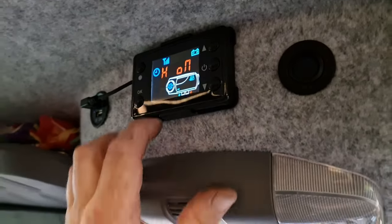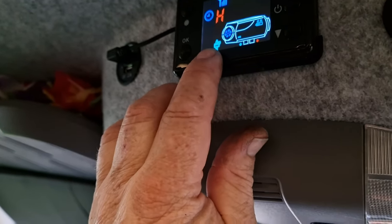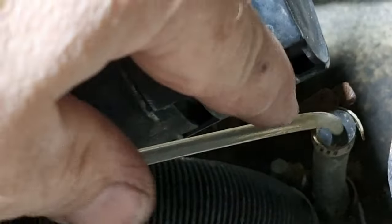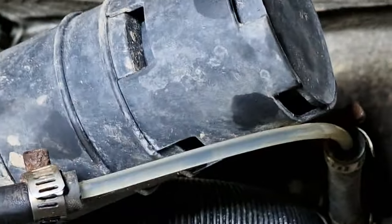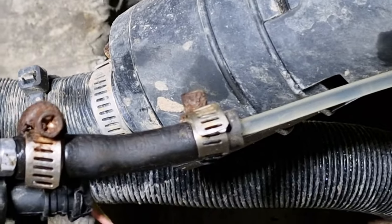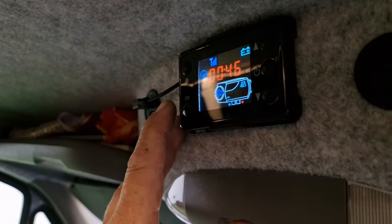It might not have corrected — maybe it is quite noisy there. The pump symbol has gone off, so we'll turn it off and then try it again. We'll leave it to do its thing; once it pressurizes it should turn off. I just want to show you this — this is the line after the pump. We can see there is fuel in it; there were a couple of little bubbles moving along when we first looked. That's now settled down, so I think we're in a good position. We can fire it up and see how this new pump behaves.